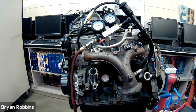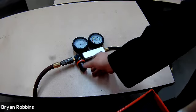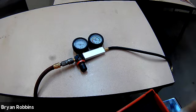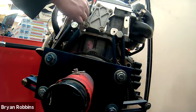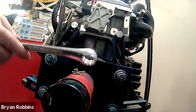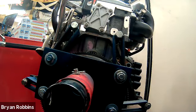Let's take a look at the process of doing this on the rest of the cylinders — it's just a repeat of what we just did on cylinder number one. We've disconnected the gauge from the engine and we're checking that the needle is still in that 'set' area, which it is. So now we're ready to get the engine rotated over so that we can start on cylinder number two. Go back to the back of the engine and release the vice grip that was holding the engine in place.